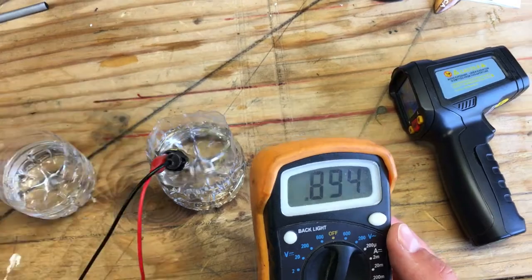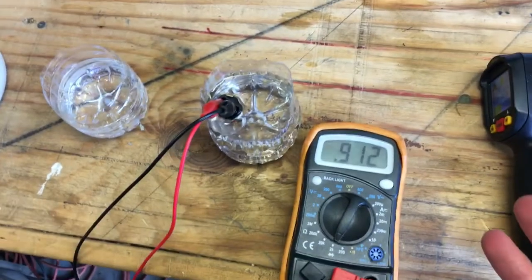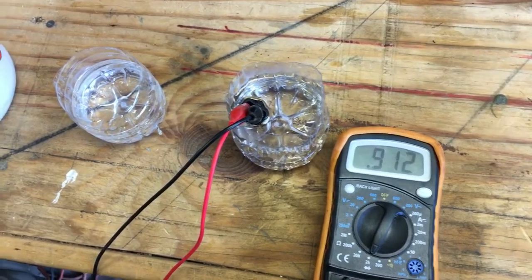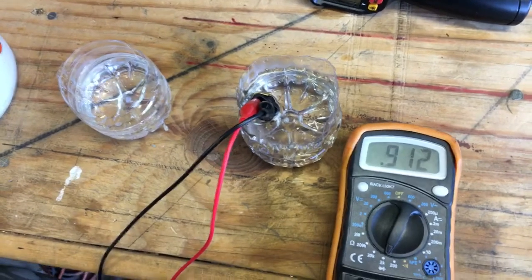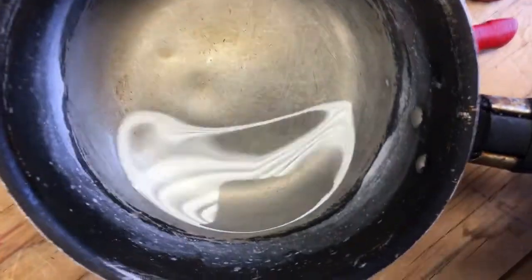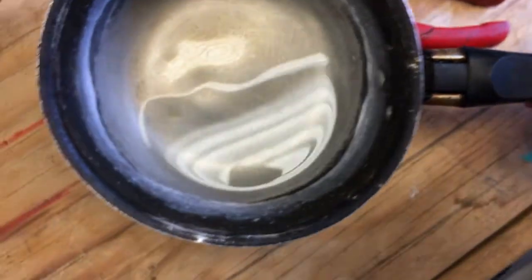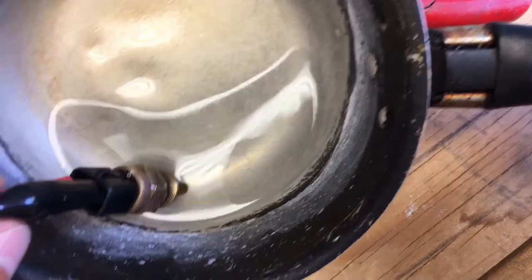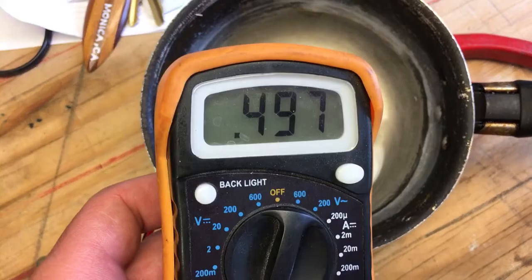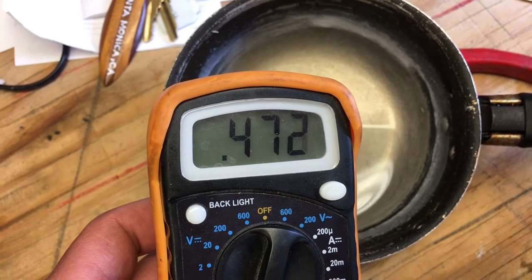The next water is super hot. Your thermostat usually opens at about 90 degrees Celsius, plus or minus five, so that's when you really need to test the temperature sensor. Our hot water is about 75 degrees Celsius. At 75°C the sensor should read about 400 to 500 ohms — and ours is in specs.